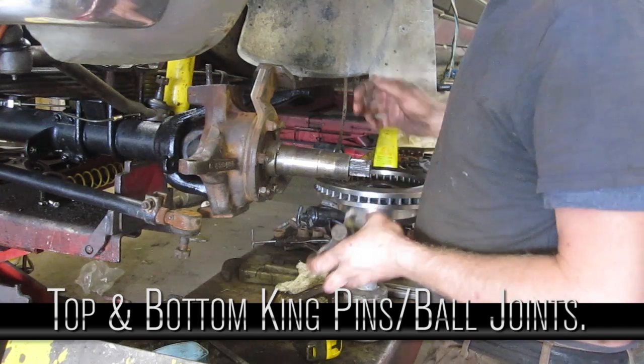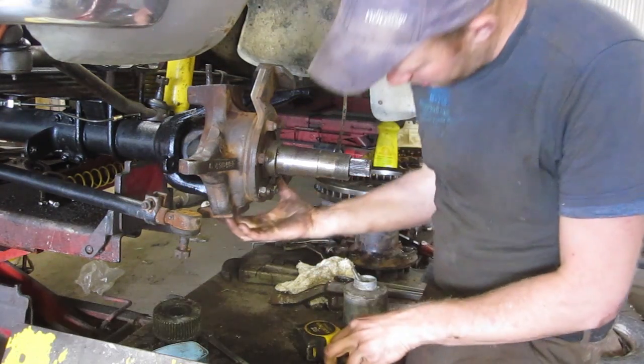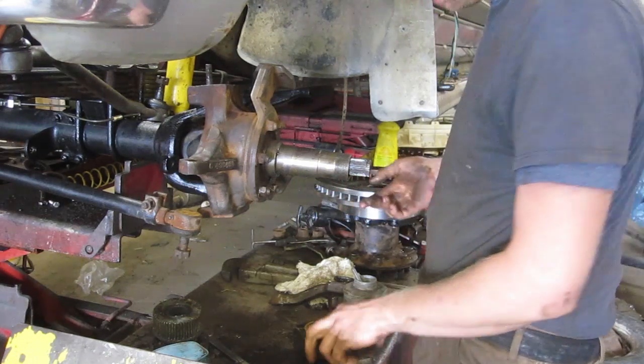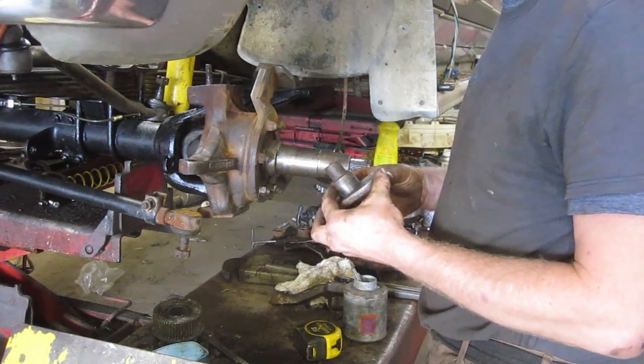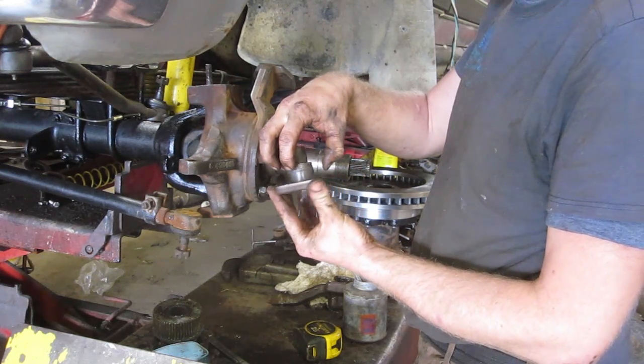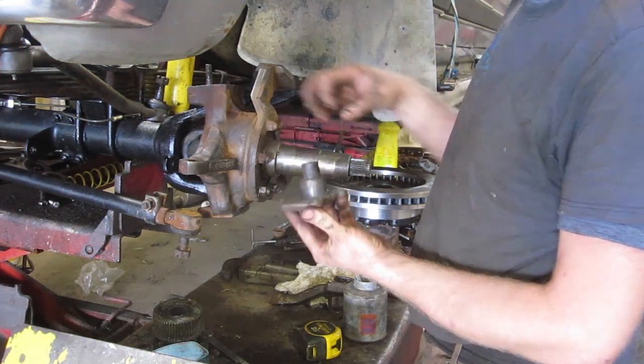We're gonna pop this bottom cap back in again. The bearing is in there. We pulled that out. We packed that full too and put a new seal on the bottom of it. And it doesn't ever really go any farther. The bearing usually doesn't need to be replaced because all it ever does is move that much.